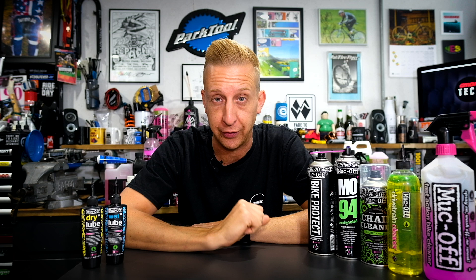Before I talk about specifics, let's deal with the elephant in the room: household products and car products. First up, washing up liquid. A lot of people say you can use it — it doesn't harm your bike, does a great job, and it's cheap. Others say you shouldn't use it because it's full of salt that can corrode your bike. Yes, washing up liquid does have a fair bit of salt, but so do dedicated bike cleaners — that's not the reason to avoid it. Washing up liquids are designed as a detergent to lift grime and food off your plate, and as a result they can leave a shiny residue. You really don't want any residue on a bike because it can interfere with your brakes and make your paintwork look streaky. You're not guaranteed a good finish, but technically you could get away with washing up liquid.